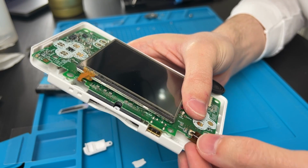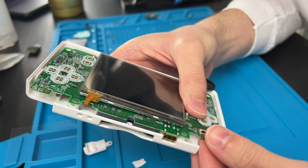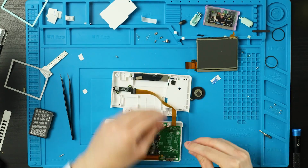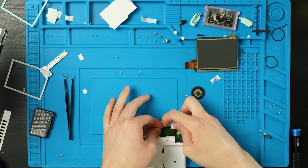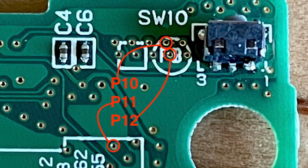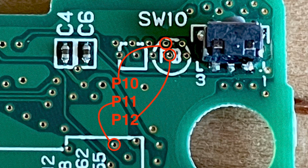However, I think it was just the fact that this ribbon cable is extremely annoying to deal with in this position. Since you aren't supposed to crease ribbon cables, this one kept pushing the L button out of place over and over again, to the point where I was getting real life angry at this mod. I genuinely recommend soldering if you're comfortable with it so you can route the wires through somewhere else. Literally route them anywhere else.